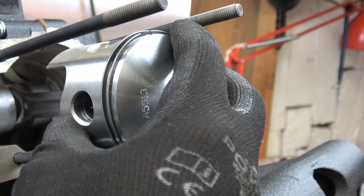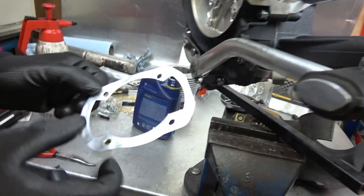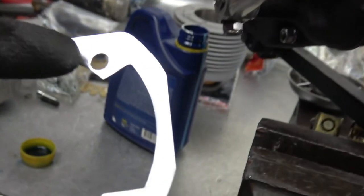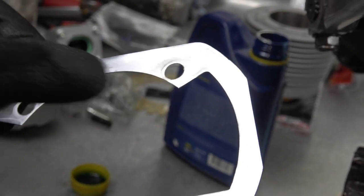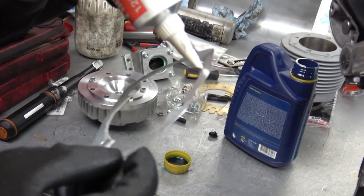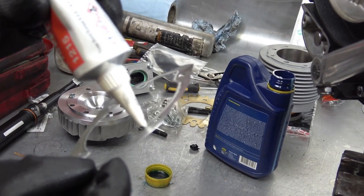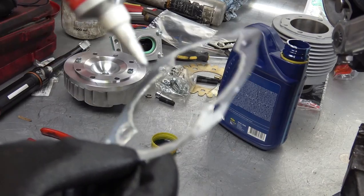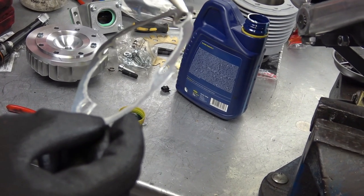Give it a rotate, make sure it's definitely sat in the groove. Looking at the base gasket now — you can see there's really not much aluminium between the edge of the stud hole and the gasket, so I'm going to be quite generous with the gasket sealant on this one. I'm sealing this without checking the squish because we haven't got another gasket, so the squish is going to be whatever it is. Last time we did this, the squish was already big at 1.8 mil.